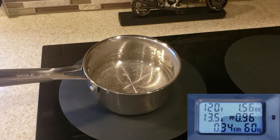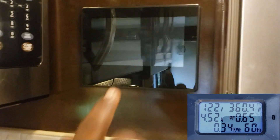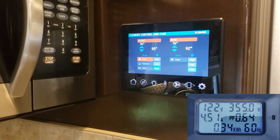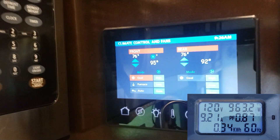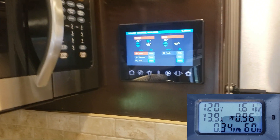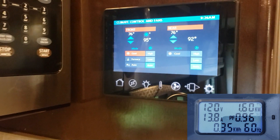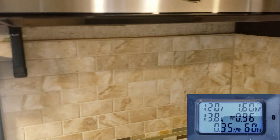We already got boiling water. Let's shut that off. Next thing we're going to do is fire up the AC. I do have soft starts on my AC, so it's going to turn on the fan first, then the compressor. I would ask you guys — if you are going to use any kind of generator power, consider installing a soft start on your AC. We've got the fridge and the AC running now. Let's go do a sound test on that.